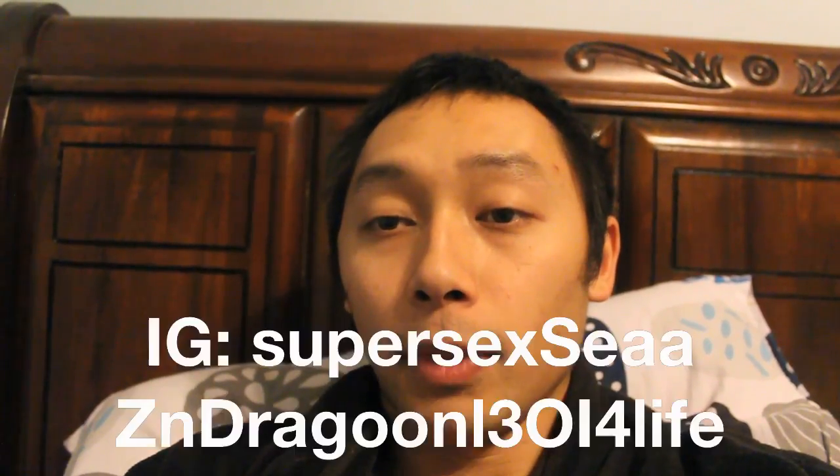Hey guys, I'm going to end the video here. This is pretty much it. You already sanded it to 80 grit, and then you're going to switch to 220, and you keep going until everything's perfect. And then from there, you prep the car to paint, with the sanding block and all that goodness, and then just get the car painted or wrapped, and then you're done.